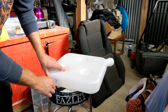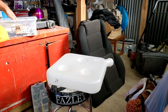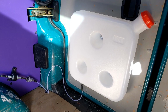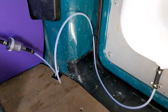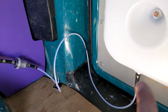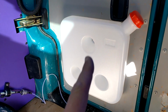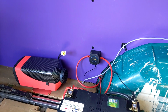And then pull the cable out. Simple as that. And it's got to fit a few attachments on, a nut and a washer, that kind of thing, and then I'm going to screw that to the van door. So that's the setup. Now put a little cable tie in there just to keep things away from the door shut, so when you open this up it extends out, and when you close the door you just got to be a little bit careful guiding this around. Not sure if this will be a permanent fixture, but for now it gets fuel to the diesel heater.